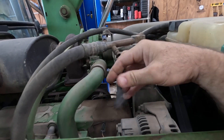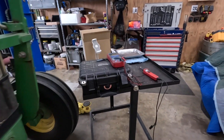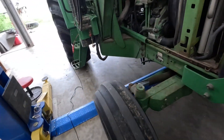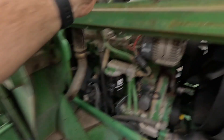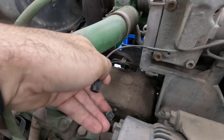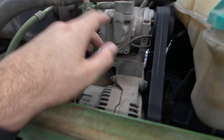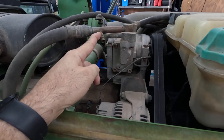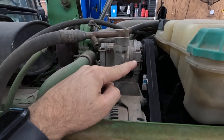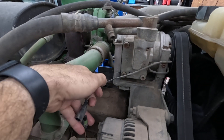So what I'm going to do — I just disconnected this. First thing I'm going to do is check the power to it. I'm going to use my good old power probe here, and if I have to I'll use my multimeter. I hooked my power probe up to the battery, going to turn the key on, turn the AC switch on, and see if we're getting power here. If we are not, that means it's probably an electrical problem. I cannot test the pressure to see if it's clogged up in the condenser or anything like that because I can't get the clutch on — without the clutch you can't test the pressure. So first thing we've got to do is test the electrical.